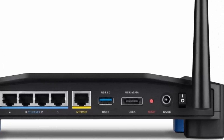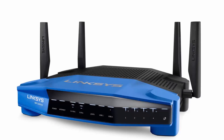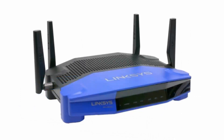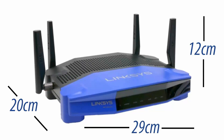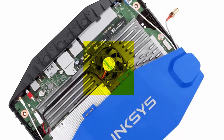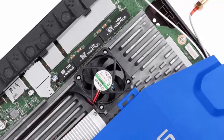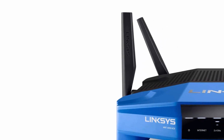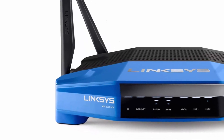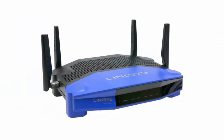Inside, this router is packed with features and is more than capable of acting as a central data point for your LAN. The WRT1900ACS has kept the same design look as its predecessor with the front half bathed in blue, and that might put some people off. The device measures in with a footprint of 29cm by 20cm and at most is 12cm high. It is wall-mountable, so it is possible to place this device somewhere less visible. The other major difference from its predecessor is that this one does not require a fan to keep it cool, thanks to the upgraded chipsets inside. This suggests a quieter router which should have a greater lifespan and require less maintenance. So the WRT1900ACS isn't going to suit everyone — its sharp blue finish and lack of MU-MIMO is certainly a point for concern — but it is tri-band, almost half the price of some of the routers in our list, very fast, and certainly should provide a marked improvement over your default router.